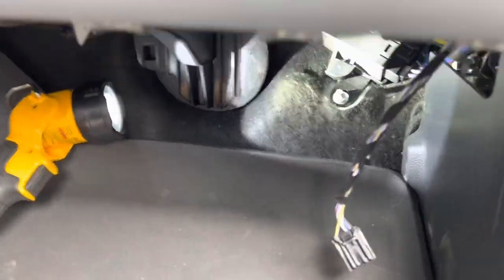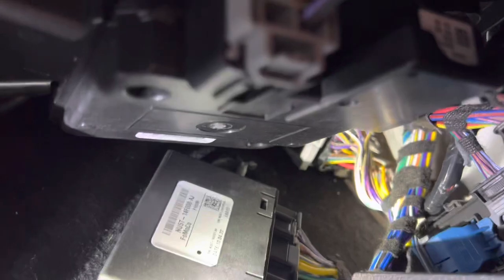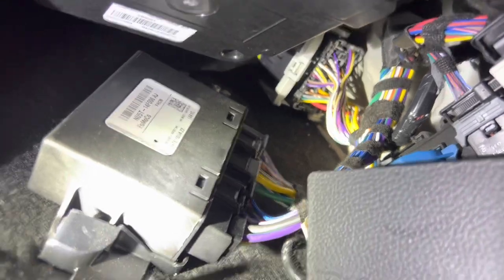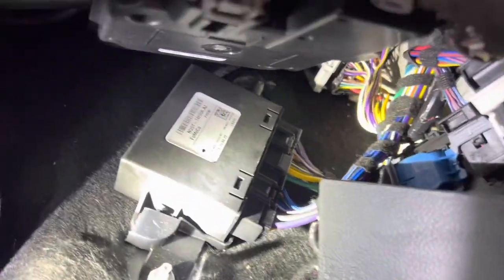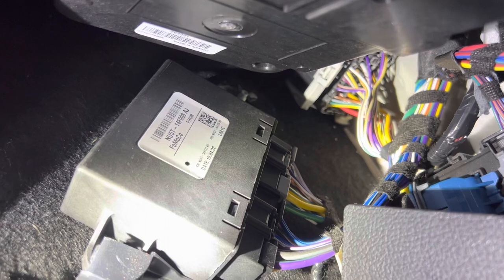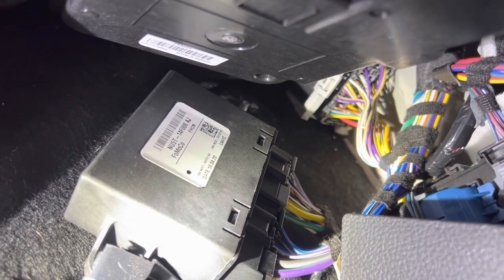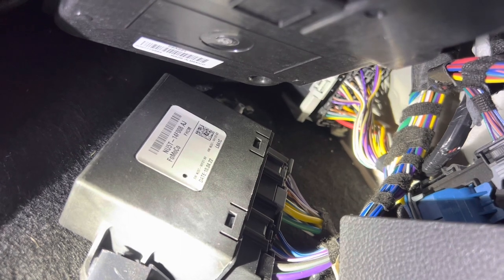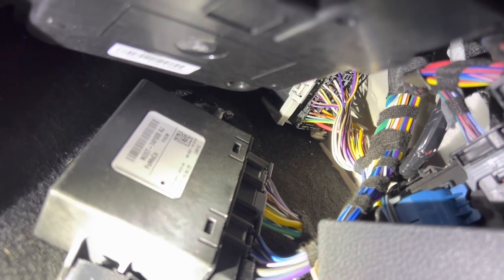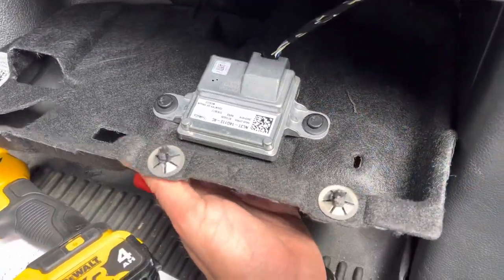I've been working on this for a while and I cannot get this thing to unseat. I've got it unhooked from the back and the clip undone with a long screwdriver, but I can't get it out. So what I'm going to do is check the wiring by color. There are four wires you need to check: a solid gray, a green and white, a gray-blue, and a brown-blue. If you can verify those are there and the other side checks out, then you should be good. Once we've verified all that, we can push this back in, get these clips lined up and reinstalled. Then it's time to take the front out.